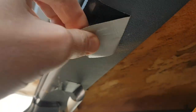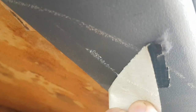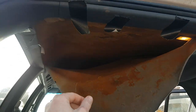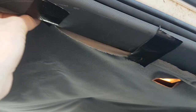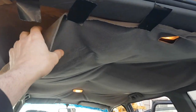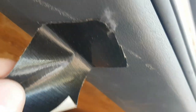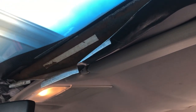Another method I've seen used is duct tape or sticky tape. While this does work quite well, sometimes when the car warms up the glue compound on the duct tape can come off and stain your plastics, and then you're going to need some sort of cleaner product to remove all that residue. I'd suggest staying away from duct tape and sticky tape on your plastics, because when the car warms up all that adhesive is just going to seep off and potentially stain or damage your plastics. On windshields you could probably get away with removing the residue using a solvent or a citrus-type cleaner.